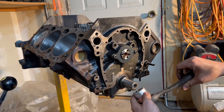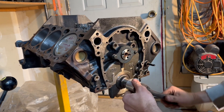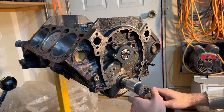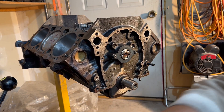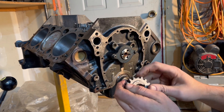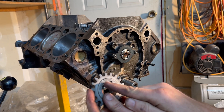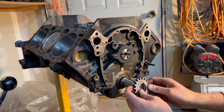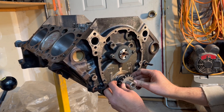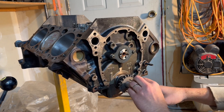Having one of these little sockets is pretty handy. I'm going to bring this around close to where we need it. I need the key sitting at about one o'clock — that's pretty close. And this gear, I don't think there's a front and back to it, except we do have to pay attention — there is a front because it has my little mark on it right there. If you can see that little circle, that's going to be how we line up our timing mark.